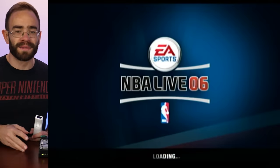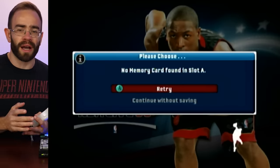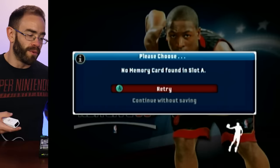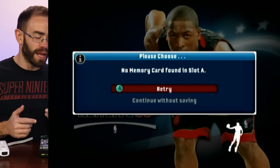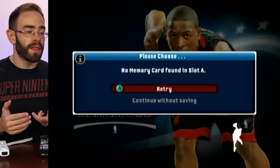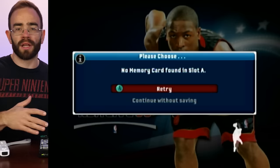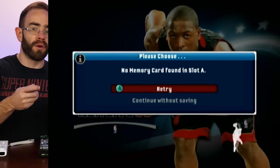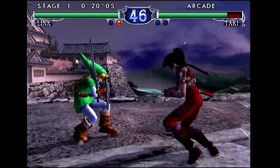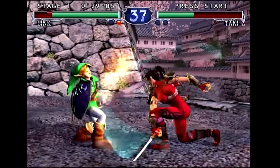What's funny about this is it looks like the ports are still there on the board itself — they could be missing a few resistors or something to complete the circuit. But from what I've seen online, it looks like you could, if you really wanted to, go about installing GameCube ports on this along with the memory card slot. Then you would have the family system Wii that is also fully functional with GameCube games. People who soft mod these systems will basically restore GameCube functionality by playing games off of hard drives or USB sticks. Because this still has the GameCube functionality technically — it just doesn't have the disc drive to play it.